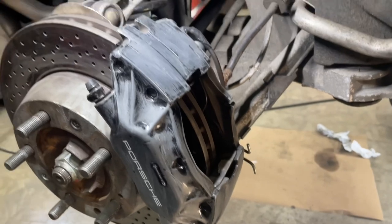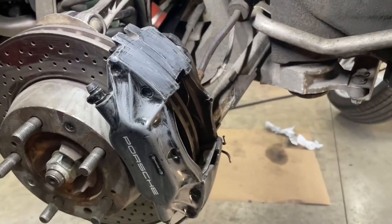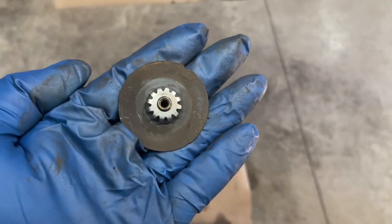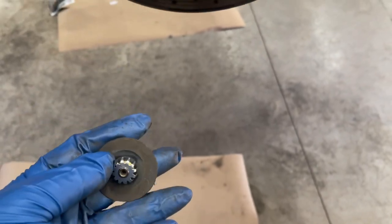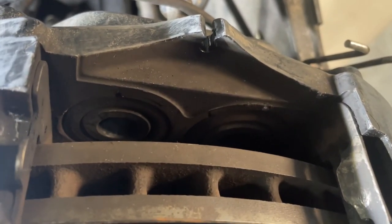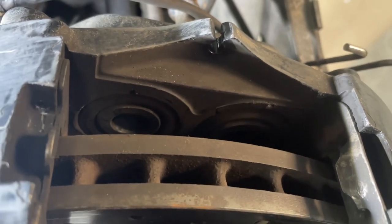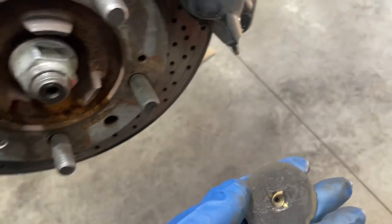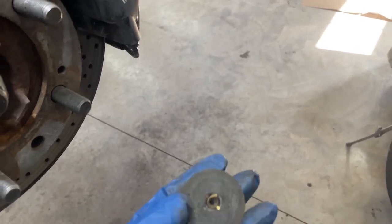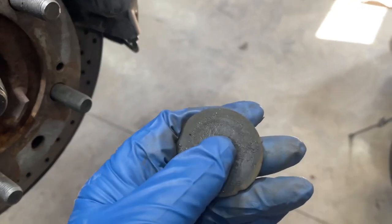I buffed this up with 200 grit sandpaper, now it's ended with the pads back in. The first thing I want to do is clean up the dampers — I hit these with a little bit of brake cleaner. There's a big one and a small one. I'm going to put them in there and then add a little bit of brake grease on the back of these pads and then slide the brake pads right in. Once the caliper pushes, these will be stuck right to the pad. The adhesive is still sticky, so I am going to reuse them.